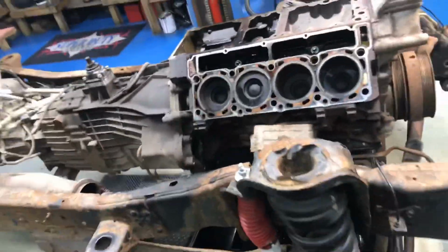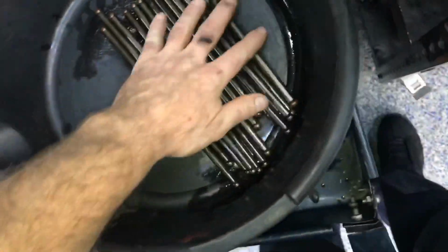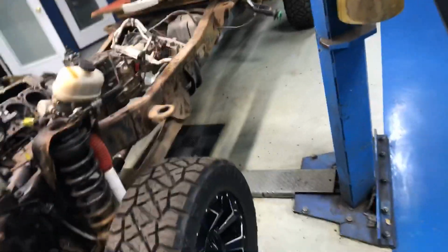we'll look at the lifters when I pull them out. If something's wrong with the valve train on that number one, maybe a valve got hung open. Push rods were not bent. I didn't see any bent ones. Now we'll double check those later. We'll roll them on some glass or something, and there's always ways. Anything else I'm missing? I'm trying to think. Thinking out loud.